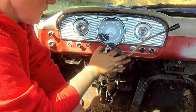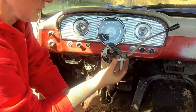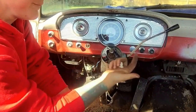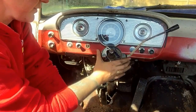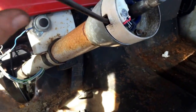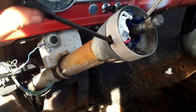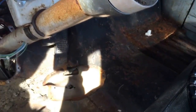Here is all the horn mechanism stuff and turn signal items. Obviously this wedge down there probably meant that the horn didn't work, so who knows what kind of surprises you'll find in here. I'm going to go ahead and remove this column shifter ring now. Remove the screws that hold this plate down. Make sure you remember to pull that spring out. Twist off your turn signal rod — just like that. Put it in the bag.